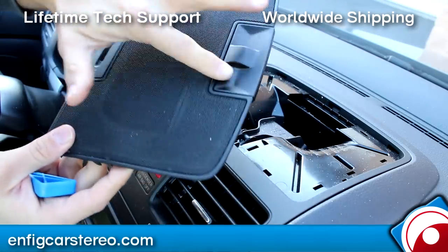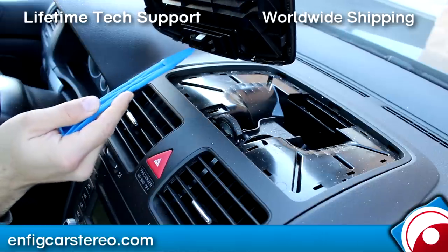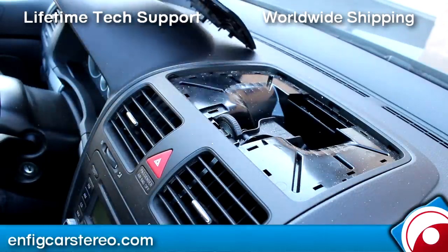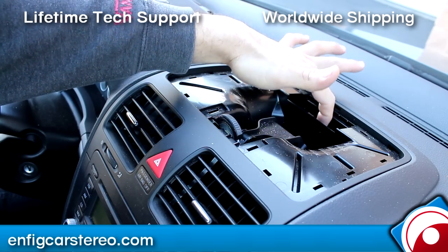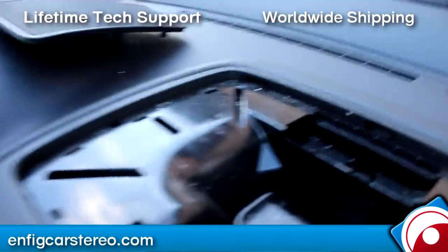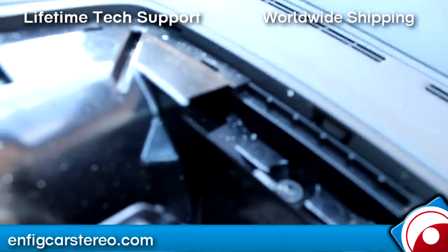This is a little thing — some cars have a sensor there. I think the ones that have it are the ones that have the non-digital climate control. And then when you look in here, there's actually one T20 Torx screw in there. Let me see if I can move the camera to show you. And that's your one T20 Torx.